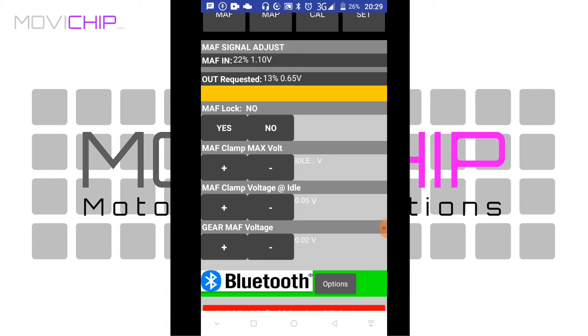For example, if you've got a car with a MAF sensor and an atmospheric blow-off valve, when you change gear at 7,000 RPM, when you come off the clutch you're going to get a bigger vacuum than at idle. At that point we can send a fixed voltage to the car's ECU. You can use this feature to try — we make no guarantees — to stop the rich condition that you may get when changing gear, when the valve is venting to atmosphere and that air is still passing through the MAF sensor giving you a rich condition between gear changes. We can't guarantee it will work for your particular application, but the option is there.